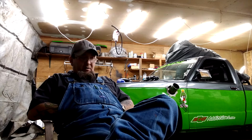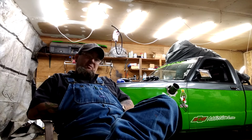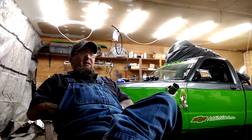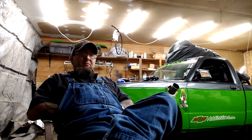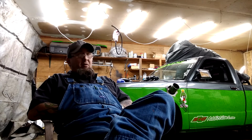It's got some boost reference power valves that we put in it that I got from a company. We bought 2 from this guy in Australia, and I actually didn't care for the way the adjustment worked on them to adjust the pressure for the fuel pressure. So I went ahead and bought 2 from this other outfit that actually builds them and has got testing and background behind it. They were $130 for those 2, but they're a lot better power valve, a lot better design, a lot better looking, and to be honest, they look almost like a CSU power valve.